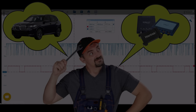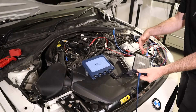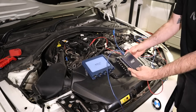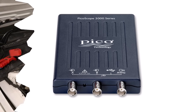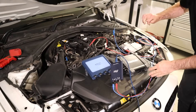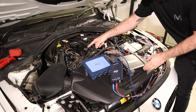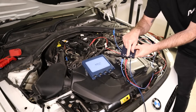We're going to check it out today. I'm connected up to this BMW B48 engine and we've got a few oscilloscopes here to try out. I'm currently connected up to the 2204a - we are in the back of the engine control module for the crankshaft sensor and we've gone into the camshaft sensor directly, measuring on channel A and channel B.